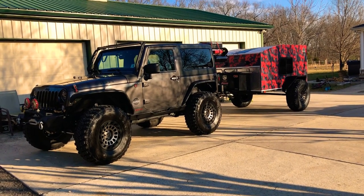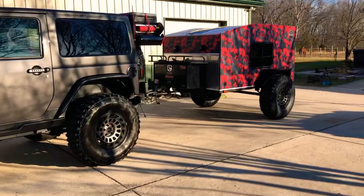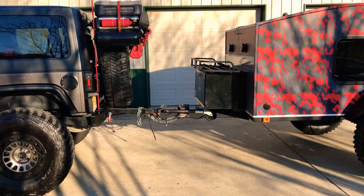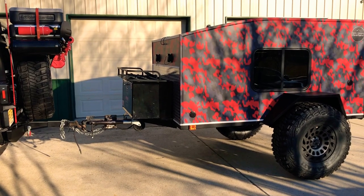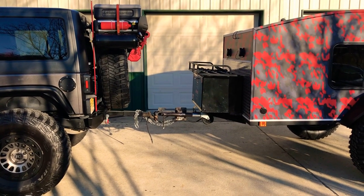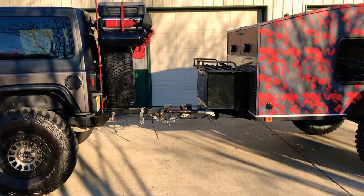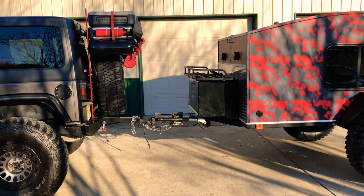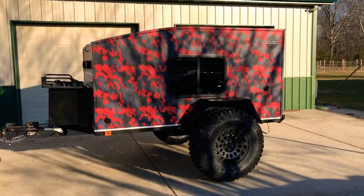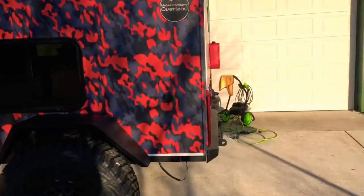I did notice there's a lot of sway in the back, so I was trying to fix that up with the coil bags. You can see I need to extend the chains out longer. I haven't decided yet if I'm going to extend the tongue of the trailer and build out an A-frame to stiffen up the front, or just leave it. I want to add a lock-and-roll style connection point instead of a ball hitch, and once I do that I'll decide about extending the trailer front.